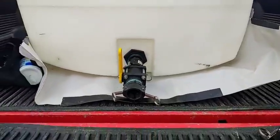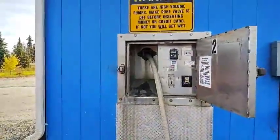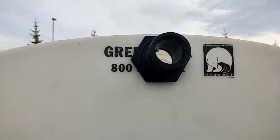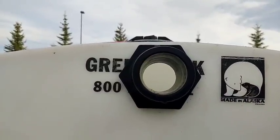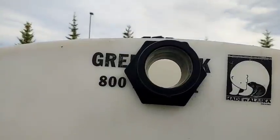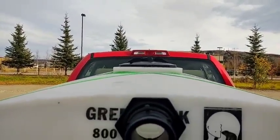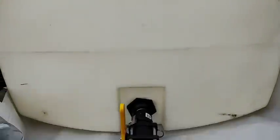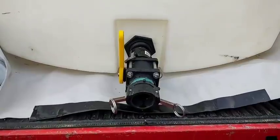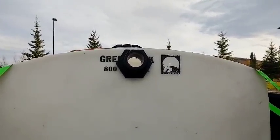There are three ways I can fill this tank up. I can fill it through this valve right here using a male fitting that comes right from the pump, or there are other fittings at different pumps that will fit right through this inlet hole. If this pump is being used, I can always move to another one that's open and fill it through there. Or I can fill it through the manhole up top, which I like the least because during winter that can be dangerous with all the ice. So I have two very good viable options — I don't have to wait, and there've been times I've had to wait 15 minutes just to get to this pump.